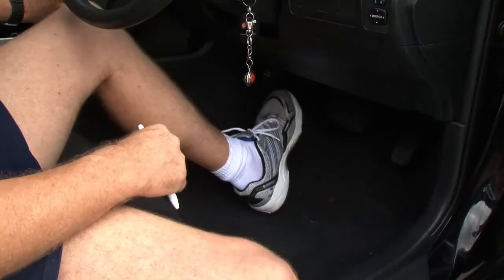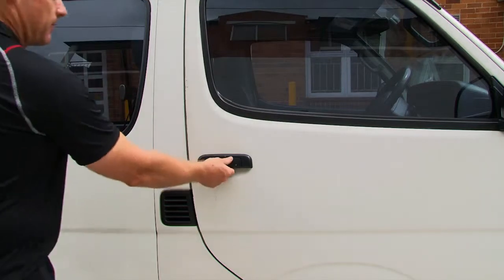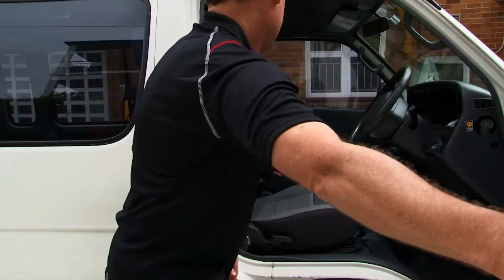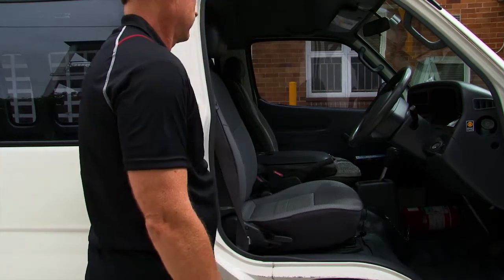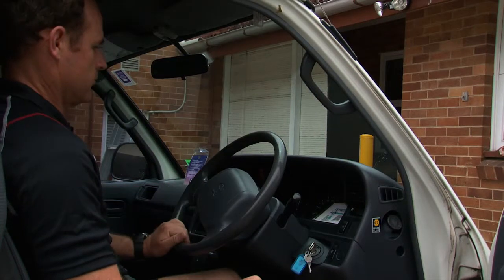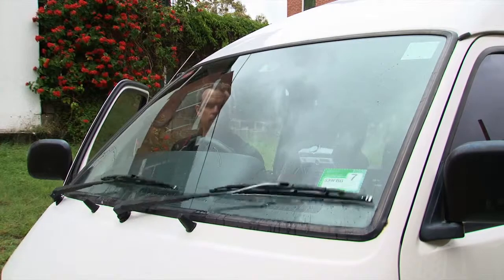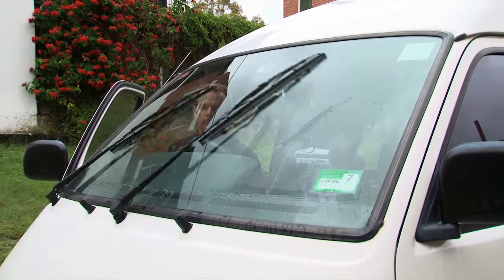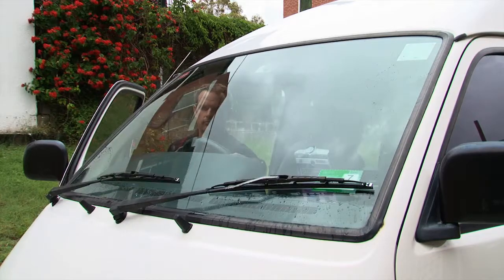With your foot on the brake, put the vehicle in neutral and ease off the brake — the car should be secure with the handbrake applied with no movement. Put the vehicle back in park; the handbrake should always stay on full. Press the horn to hear its sound and report if there is no sound. Check the fuel level is above a quarter tank — you may need to turn the key to accessory position. Test the windscreen wipers and jets are functional, and report if the wipers are streaking or jumping or if the water jets are not working correctly.